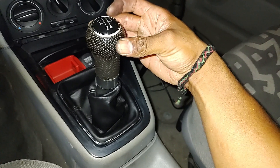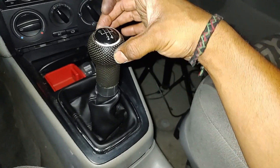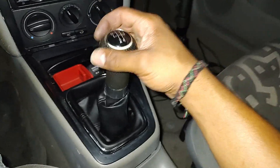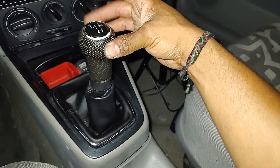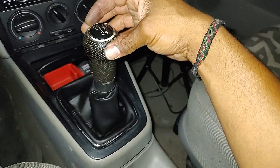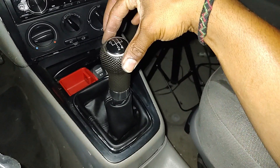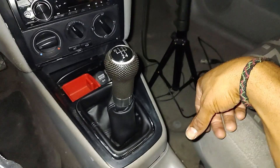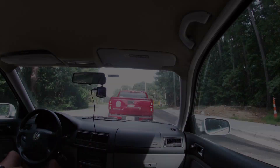So now I don't know where that play is, but there is hardly any play, I think. Yeah, that feels good. It feels like when it moves, I'm actually moving something. So I'm going to get the same camera angle I did earlier to check the play. Remember this when I go in the engine bay — you can see the cable end wiggle a little, but there is no slop. And then I finally move it to see how the new bushing reacts to actually moving it, but it looks really good.